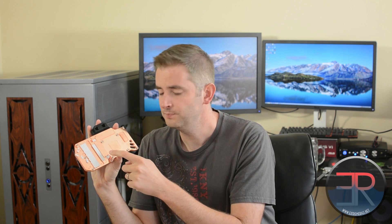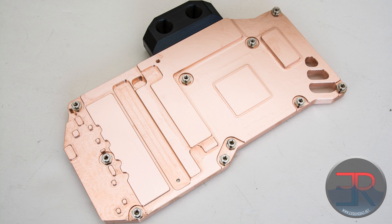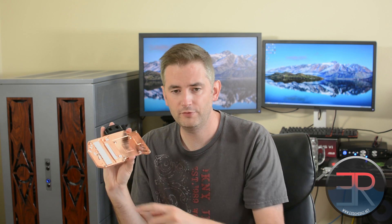In terms of thermal pads, you can see there's quite a few different areas that AquaComputer cover, and you'll also notice there's no thermal pads on the memory section. AquaComputer is the only manufacturer that doesn't do that - instead they design the block with enough tolerance that you can use thermal interface material to cool the RAM modules. What we tend to find is that pressure is not quite equal across the entire block, so some memory modules need more TIM than others and won't be as well cooled. The main VRMs are in this section here and AquaComputer, if they can get enough pressure on the VRM section, does very well on VRM cooling - we think because they use thin, high quality thermal pads.